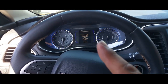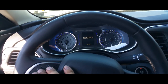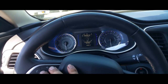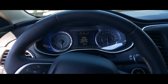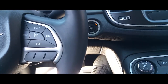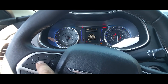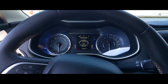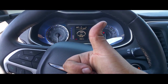Turn it on and it will show a message telling you to make sure your engine is on. Once you see that message, flip it back into on, hold OK, press OK once more, and hold OK — that should reset your oil life. There's a specific step for it. Thank you for watching, please like and subscribe.